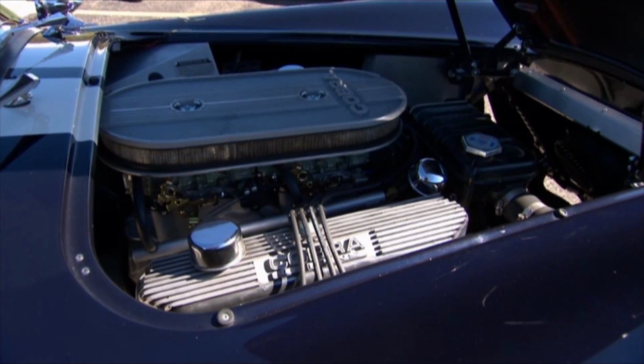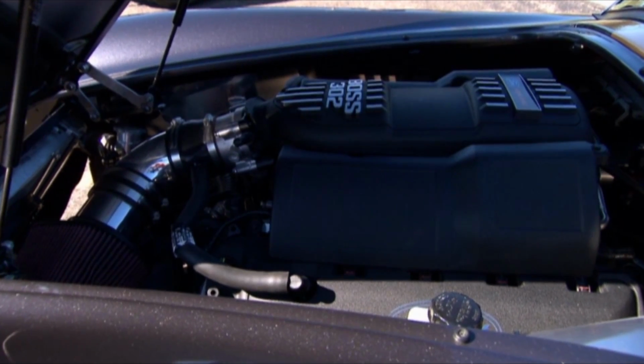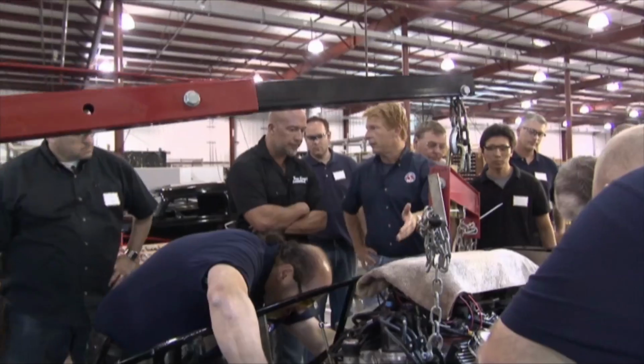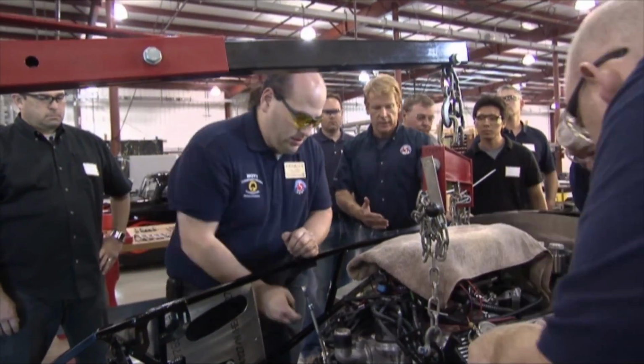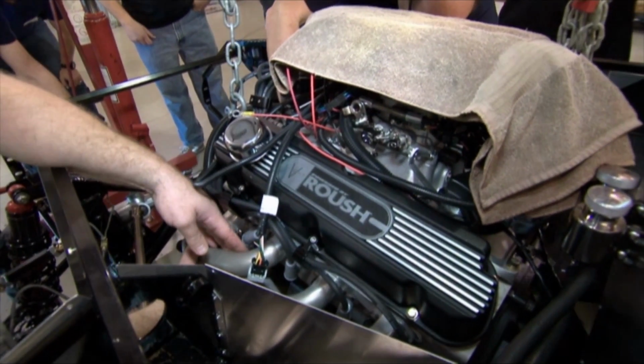Yeah, FE motors. We got an FE motor out in the truck, so you can run the FEs. Just about any Ford small block or big block you can do, modern and vintage. My job is to make sure that we're giving parts that fit. Headers, engine mounts, the right tail shaft and driveshaft, and so forth. Yeah, when a guy orders his car, we're calling up and he's saying, hey, I'm going to run a small block. We're going to say, okay, small block 289, tell me what it is, and we'll give him the headers for it.